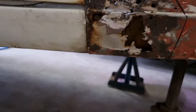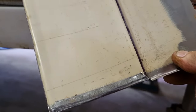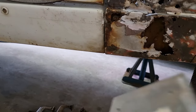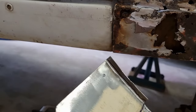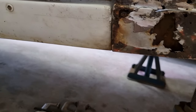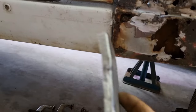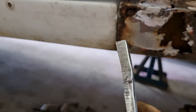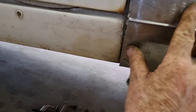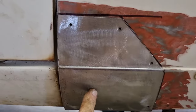So what we have here is on this lip here, got that folded back there, so it's got a nice strong edge. And then the part at the top, I've got a brake. It's a little bit wobbly, unfortunately, but it'll be okay. And I did have to put on the stretcher shrinker just to keep the curvature in it. A little bit of a lump there. It's still got all that curvature to it, and that sits back in place. Excuse me, is right to go.